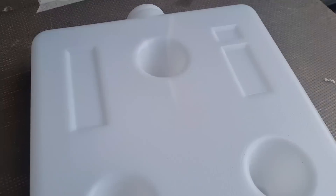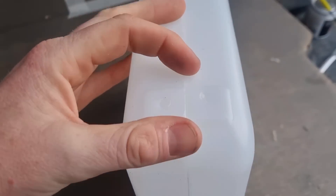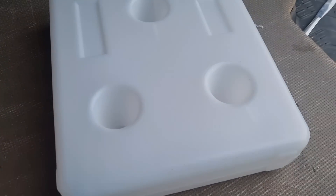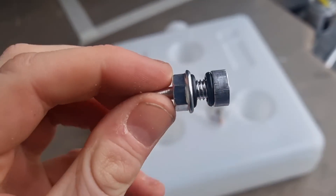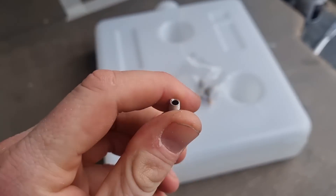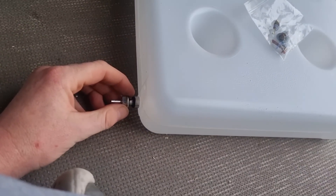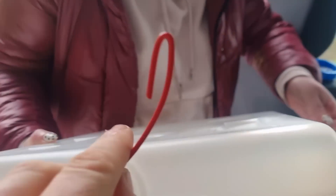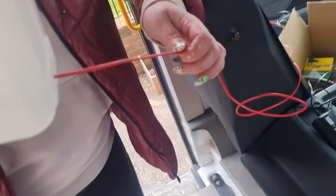The van's got a boo-boo. We've got the fuel tank and we've got to start building it all up. I've got this little noggin - I've got to take the nut off, thread that entire outlet into the top, and jiggle it around so it comes out of that tiny little hole, then put the bolt back on. The way I did it: I stuck a wire through the hole out the top, bent it over, stuck the fitting on - and in theory with a bit of jiggling that should come out the fuel fitting hole.